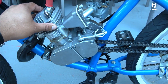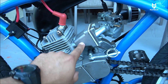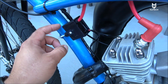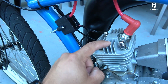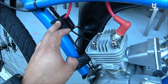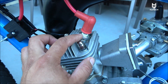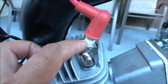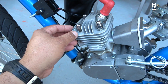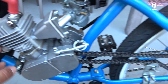That got resolved. I cleaned the ports, got the G2 reed with the intake and carburetor. I went back to the upgraded CDI from the kit — I did replace it with another one I had around, but I installed it back knowing it was not the issue for stroking. I also upgraded the spark plug to the NGK B6HS. It fits perfectly well and it's actually starting a little faster now on cold starts.